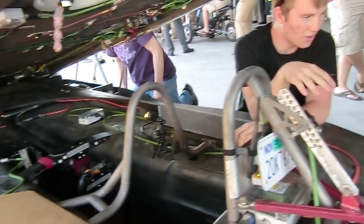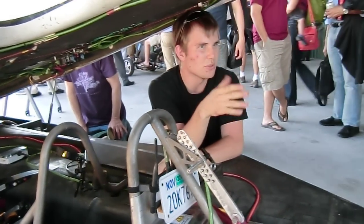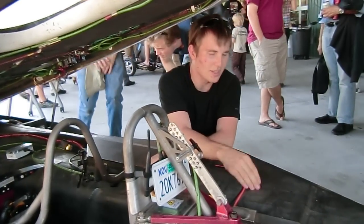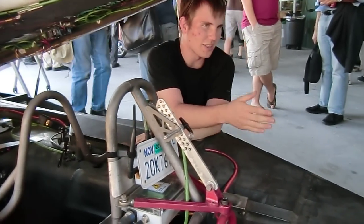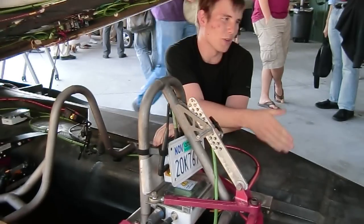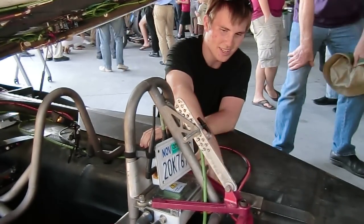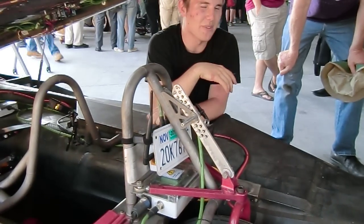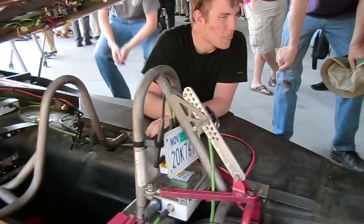The problems with this car are the code. Things will time out and fail after a certain amount of time — there are bugs where you have to reset the car every so often. There's a 30-minute bug; you fix that and then you get to the hour bug. Right before the race, you fix the three-hour bug with the battery pack, and there's a four-hour bug with this code. So you have to reset every four hours — after four hours it just stops responding. You reset the car and it works again, and you can reset while you're rolling.